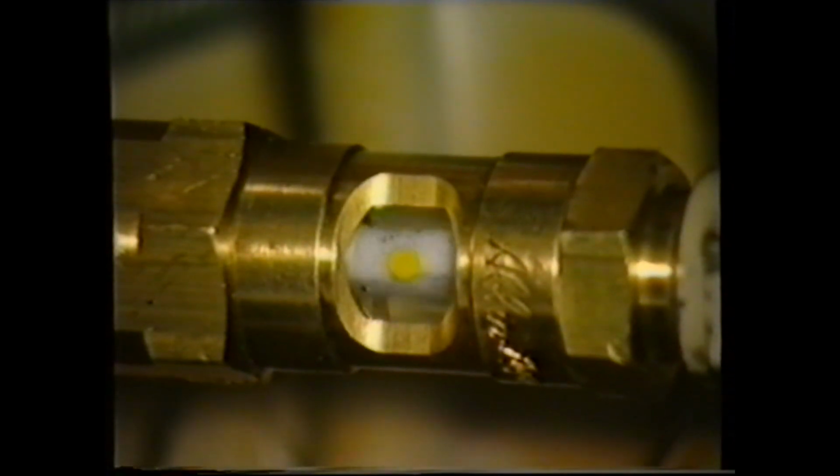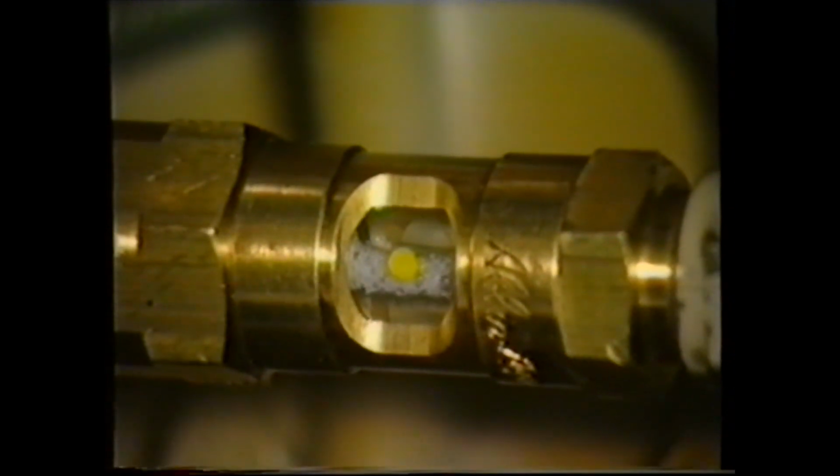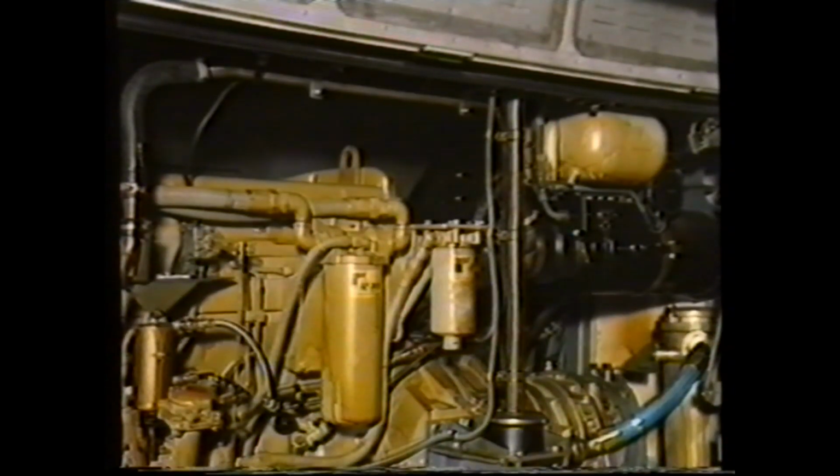Providing these are in order, you should check for air in the fuel system. If air is present, because of the expansion characteristics, it prolongs the pressure die-down when the throttle is closed or when the shutdown valve is operated. In addition to these problems, the air will also cause the engine to be slow on acceleration, and it may cause the engine to surge when at idle.